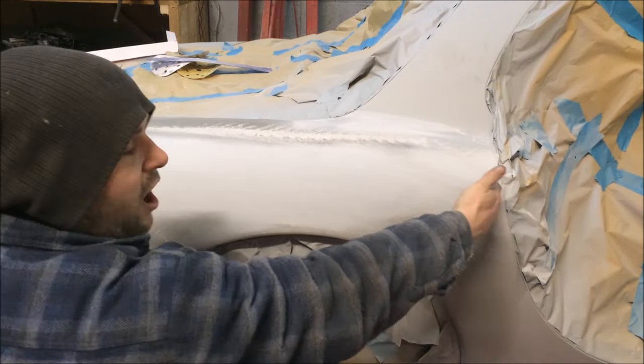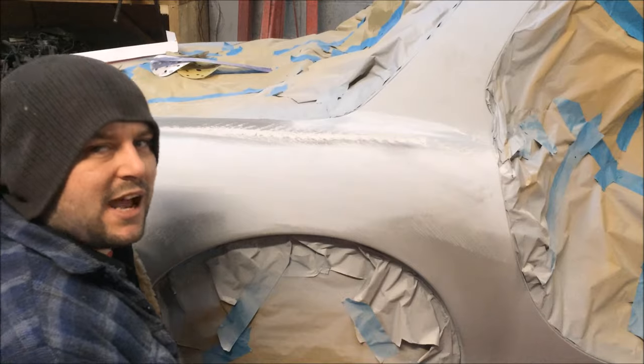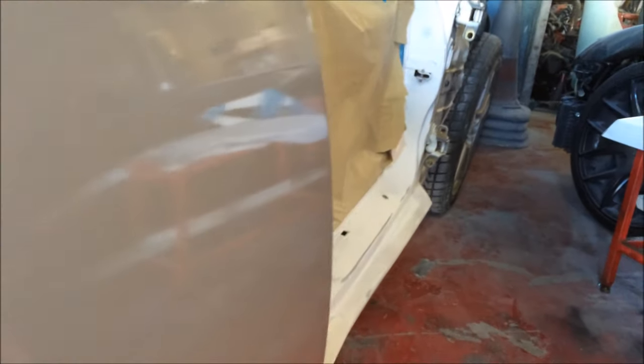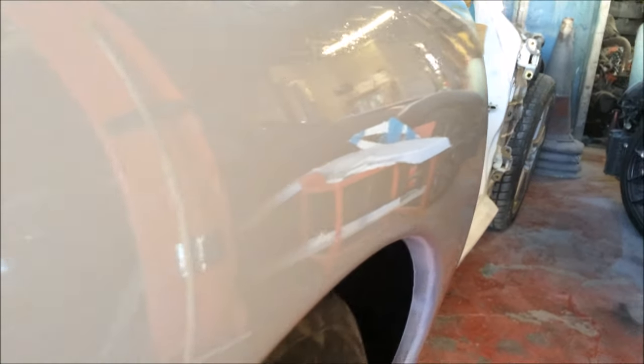Passes, we've done that whole section. Obviously the Slick Sand is easy as hell to sand anyway. It's really, really good. So this is when you know you've got the panel dead straight. There's just some Free Prep and white silicone remover. And this is the EverCoat Slick Sand, now blocked to 180. As you move down the panel, you can see there's no distortion, no waviness, no anything.